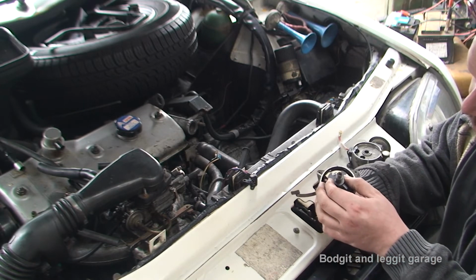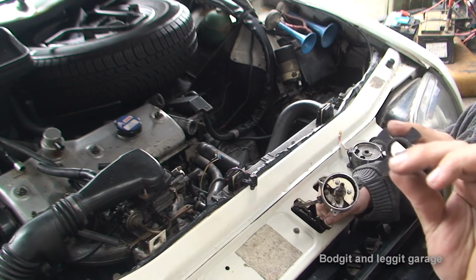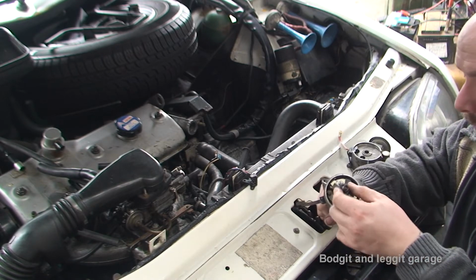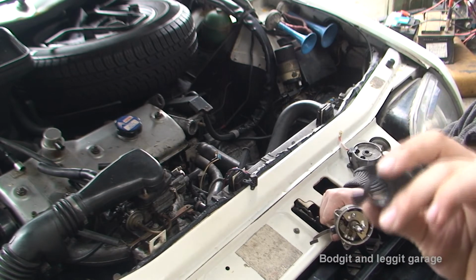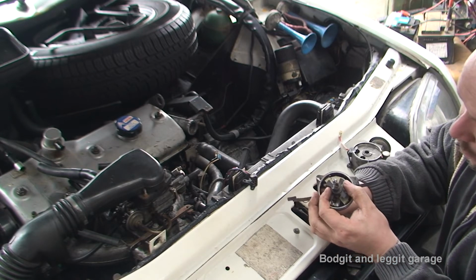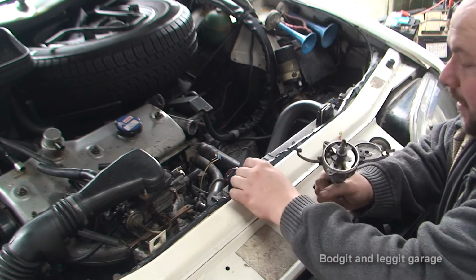Now what I've had to do is, inside it you've got these little legs. I don't know if the camera's going to show that up. There's little legs that are like little grippers, because this is designed to fit onto the rotary arm and grip, but obviously we're not doing that. So I had to skim away 3 of the little legs inside and leave 3 there. And what that allows me then to do is to fit this and move it, which you might be able to see, move it the 2 mil to the left, which then lines it up with everything.